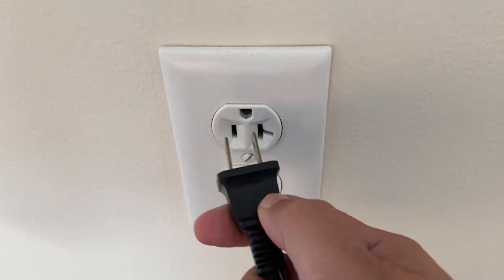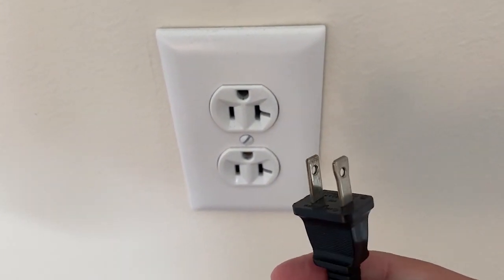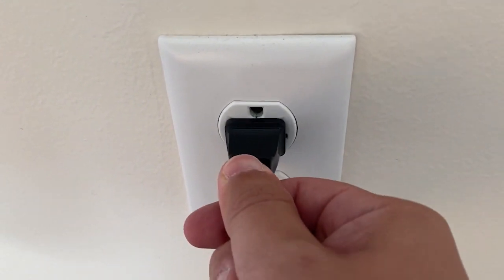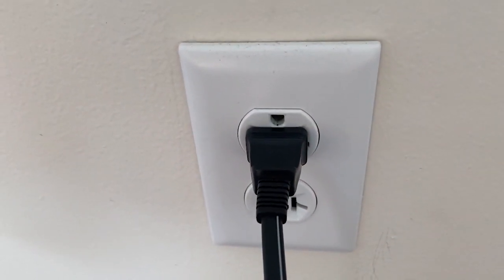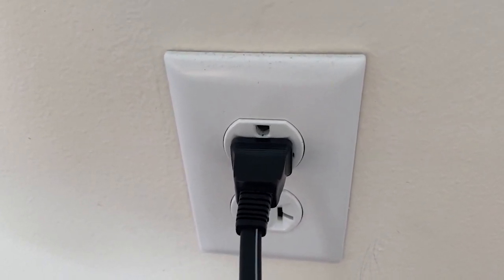The first one — it's the easiest one to try — and that is to unplug your TV from the wall outlet and wait 60 seconds. Don't be impatient here; wait the whole 60 seconds, then plug it back in. This is very different from turning off your TV with your remote control. This is called a hard reset of your TV, so make sure you do this method.